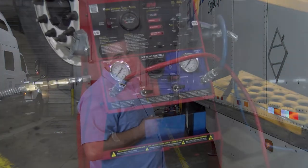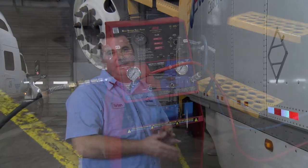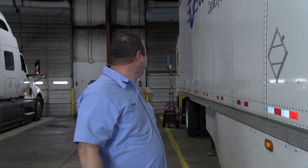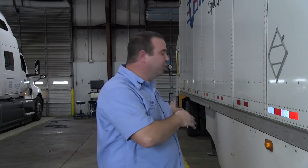First thing — we've got our MUT tester hooked up back here. Remember, this is simulating your truck, as demonstrated in another video. Right now we've released the trailer brakes. This is very important — safety first. Make sure when you're getting out of that truck, you've released the brakes. You push the red valve in, and that yellow valve needs to be popped out. Make sure those tractor brakes are set before you come out, because remember, you're getting underneath the trailer.